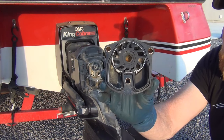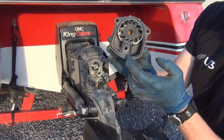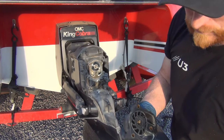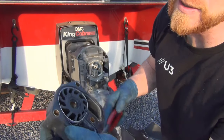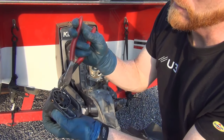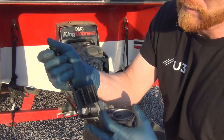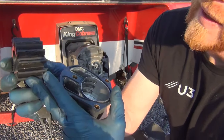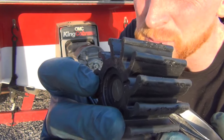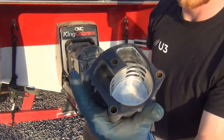When you go to take this off, you'll find that the impeller is located inside the housing. We've got an o-ring that's separating — that's why I like to glue mine in ahead of time. This one's actually not too bad, seen worse. As for the impeller, when you get into these sometimes they look fine, but when you look at the leading edge you'll find that they're all torn up. If they're torn up then they don't get a good seal. As we pull this out, you can see the leading edge of this is just all ripped to pieces. Don't be distracted by the handsome red beard — just look at the impeller. That's going to cause it to not seal well and you're not going to get good flow.